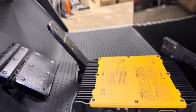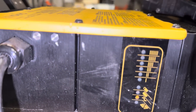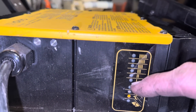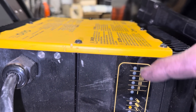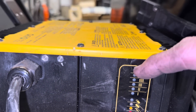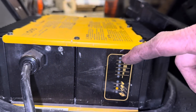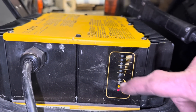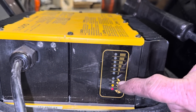The charger is kind of misleading. You'd think it goes to dead and shuts off, but it doesn't. It slowly goes up — one, two, three, four, five — then when it gets to about half charge it holds that number. As it gets to full charge it comes back down, lights up at 80% charge, then another light at the same spot for 100% charge.